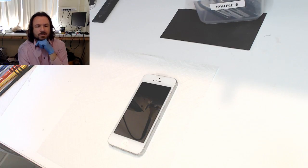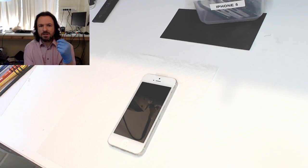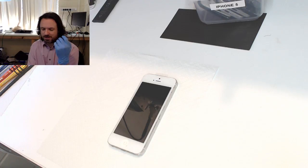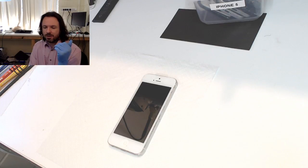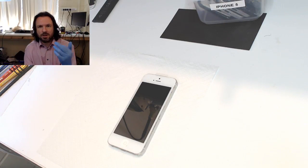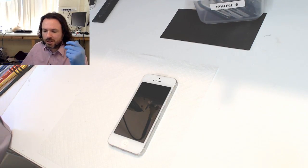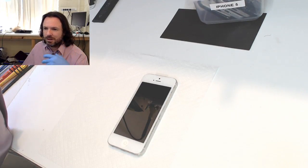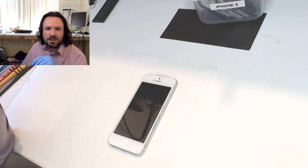Okay, so it's like a permanent hue change. Could it be possible then that the assembly process, because obviously they're put into the vacuum autoclave, at least unless they're using some really cheap nasty stuff, could it be that because of that process, the pressure that the screen, the fusing goes under, isn't right, say it's too much or whatever, as you say, could that be then over time what's causing them? So I guess you could say, while it's not explicitly the fact that they've been refurbed that's causing it to go pink, it could be indirectly through the fact that the pressure hasn't been done right or something like that. CCFLs can take a hike.